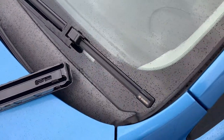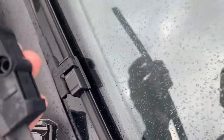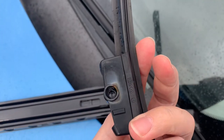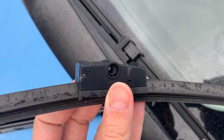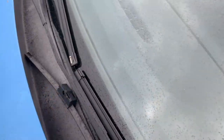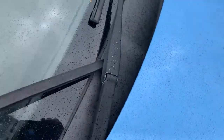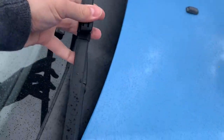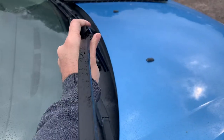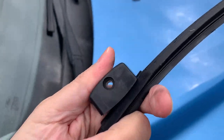Job done! Although these blades are very easy to fit, they have connector holes on both sides, and I did notice a while ago that the previous ones were not put on the right way around — especially that one over there — and it did create a strange noise. Instead of being aligned with the airflow, it was put against it, and that can cause some noise. I don't know what brand that was, but definitely not Bosch.